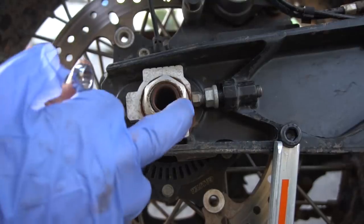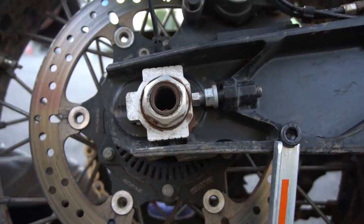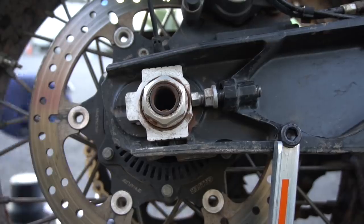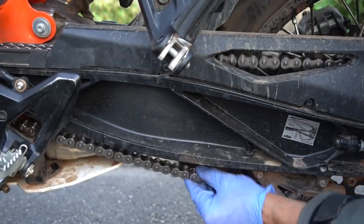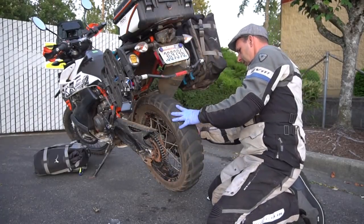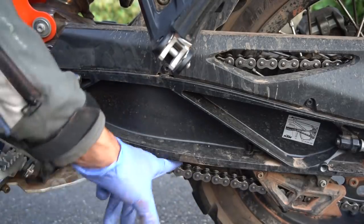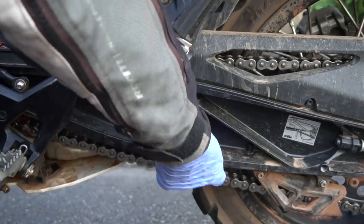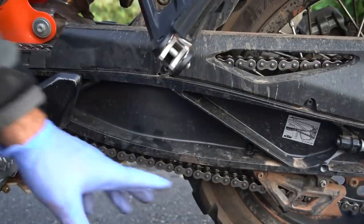To tighten the chain up, all we're going to do is back this nut out — that's going to push the axle backwards. Each time I move it, it will move the axle just very slightly, so whatever I do on one side I do on the other. When you adjust the chain it's very important that you check on both sides, make very small adjustments, and check constantly as you're going. Worst case scenario you make it too tight — you loosen it up a little bit and kick your axle forward. What I'm measuring is the center of the chain where it has the most slack, checking from the bottom to the top — the distance between those should be about 25 millimeters, just enough where it should touch the swing arm.